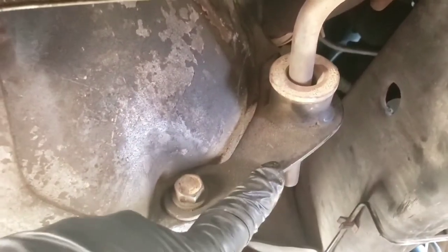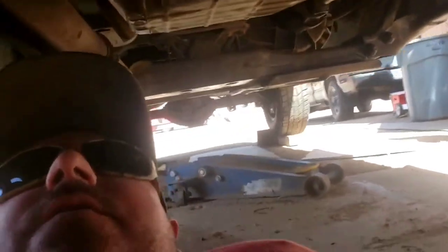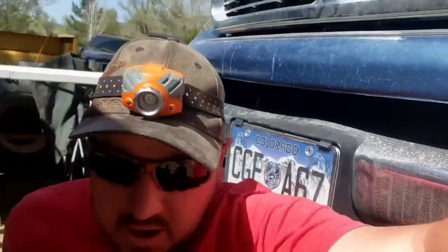The exhaust bracket shares some bell housing bolts, and the transmission dipstick tube made a little bit of a mess, but not too big of a deal. We're torquing the torque converter bolts and have the rear driveshaft to reinstall — otherwise we're pretty much done reinstalling this transmission. We decided to go ahead and reinstall so we could at least move this truck out and get it back under its own power to diagnose the issue further. Praise God, thanks for watching guys, and I'll see you on the next one.